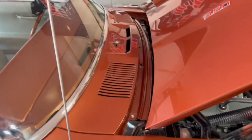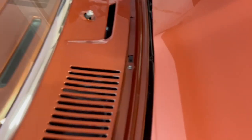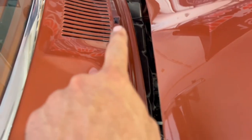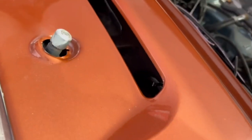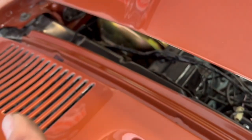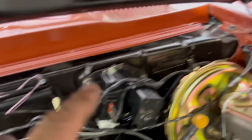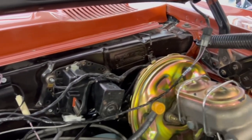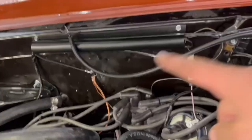The cowling is all put back into place with four attaching bolts — one, two, three, four across. If you look carefully you'll see a little black tab — there's one over there too. Those are your wash nozzles that poke right through the cowl panel there. Those are plumbed into place. Now I need to run the smaller hoses that came with the washer system from the pump up there to those washer nozzles. Here's the other end of the nozzle poking through — all I have to do is run a loop from there to that one over there.